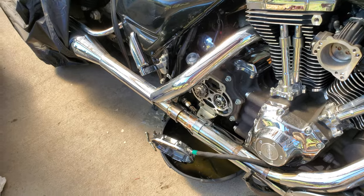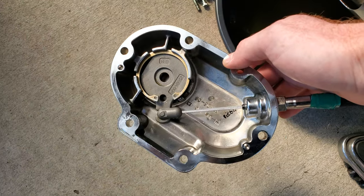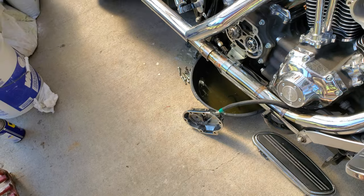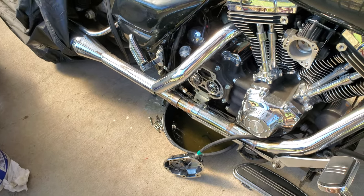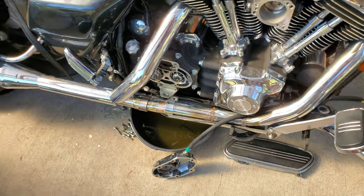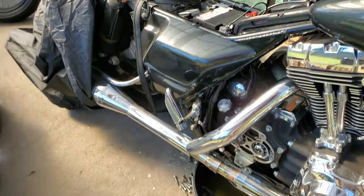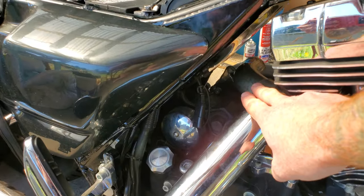Lastly, as a stupid mention: I bought Harbor Freight snap ring pliers to pull my snap ring out to do my clutch cable, and that thing would never do it. I wrestled with those interchangeable-head snap ring pliers from Harbor Freight for way too long, then just went out and coughed up some money on a more expensive set. So just be aware — get proper snap ring pliers before you start.